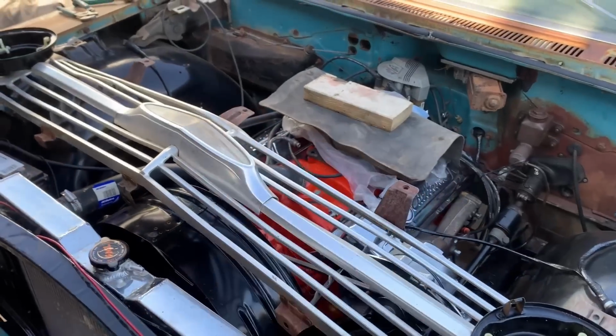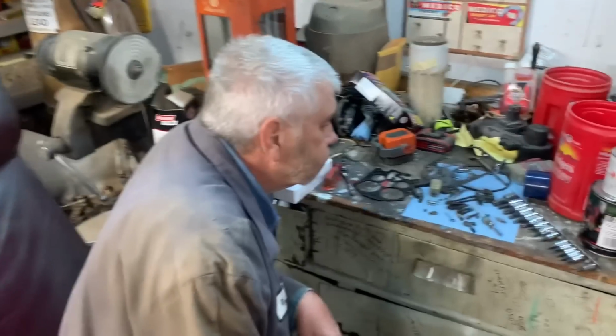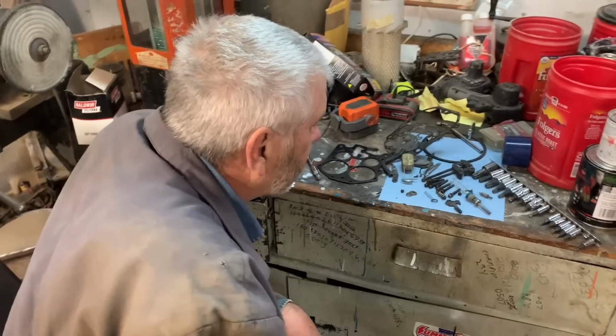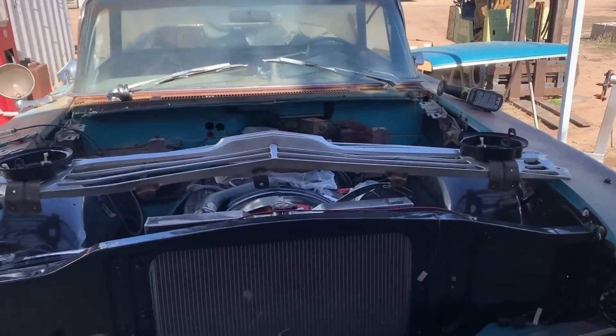And if you also notice, we have the carburetor off because Dad's rebuilding it, because when we would run it, we'd pour gas down it, run it, then it would die. There was a type of seat in there that was really hard to blow through, and it wasn't letting fuel in. Oh, we got a kit for the carburetor. We're gonna fix the fuel delivery problem, and while it's apart, we're just gonna rebuild the entire thing, get it set on there, so that we can finally drive it.